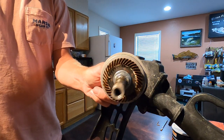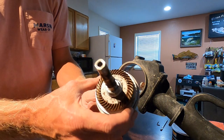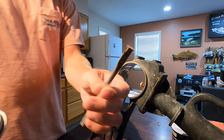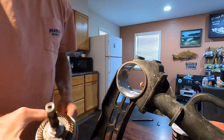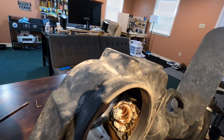We got a little rust going on in there — somebody's been neglecting it. These gears we're going to clean out. I'm going to use a rag and then a brush — a wire brush would work but this is a pretty firm paint brush I had laying around. The gears down inside we're going to clean all that out and wipe all that old grease off.